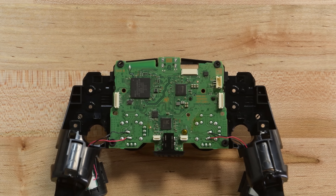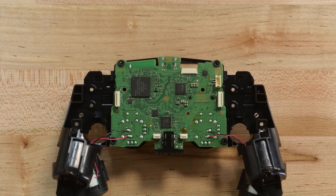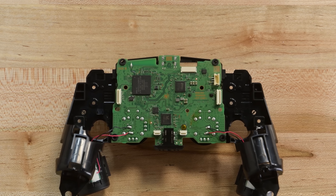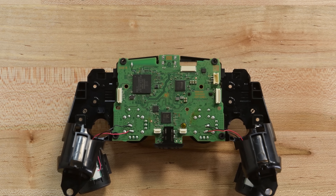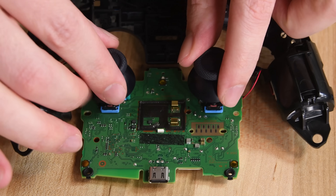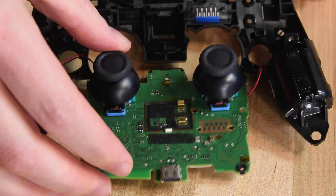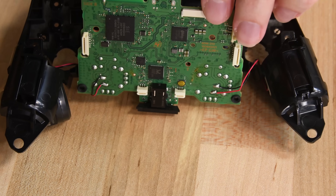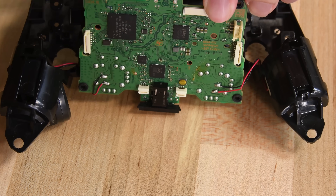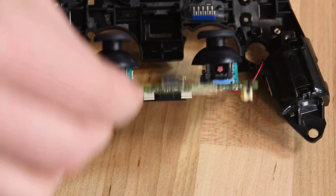Since we're leaving those motors in place for now, our motherboard is held hostage in the frame, but it's still easy enough to see all the sights. The first side is home to all those connectors we dispatched earlier, plus a few chips: a Dialog power management IC, a Realtek audio codec, and a custom Sony chip, likely here to handle all the extra processing these controllers are doing. The other side is home to the two joysticks, which look and feel about the same as the DualShock 4. And also like the DualShock 4, these sticks are soldered to the board, which is unfortunate considering they've been known to drift in the past.